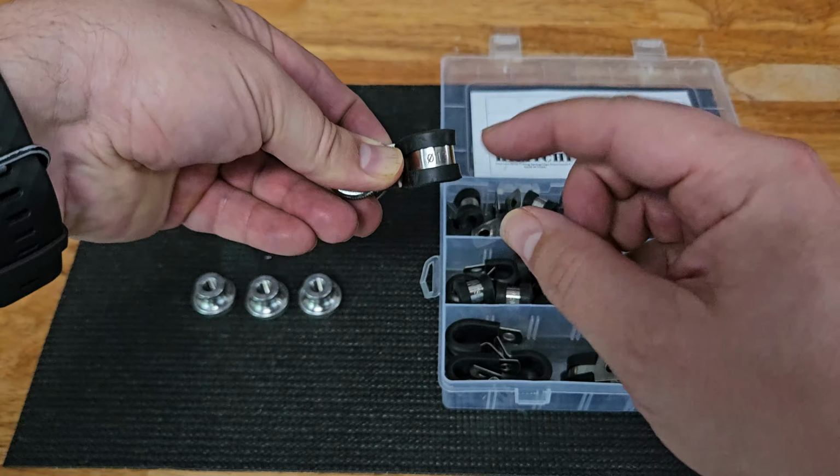I also want to show you some existing mounts on the bottom because you might be thinking, is 2 enough? Let's take a look at that. All right, so this brand of saddlebags is made by Highway Hawk. It doesn't really matter what your brand is, but these universal mounts are not just specific for Highway Hawk. So what we're starting with, and if I had not had these, we would be installing these. These require 2 holes. They mount from the inside, but you can see here that it's like a hook. And what happens is they hook directly on and that starts.